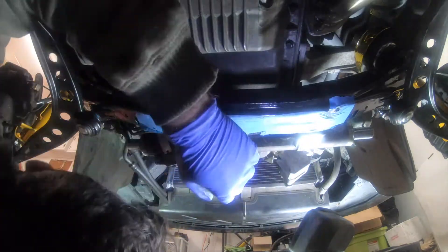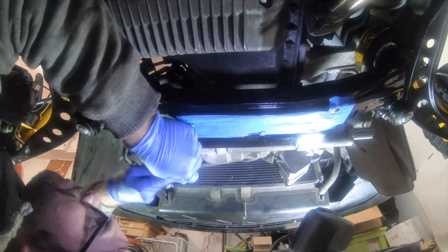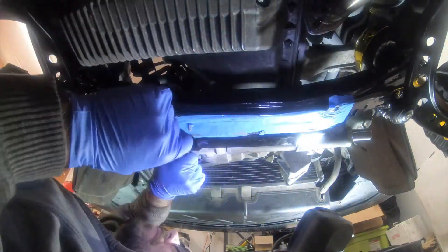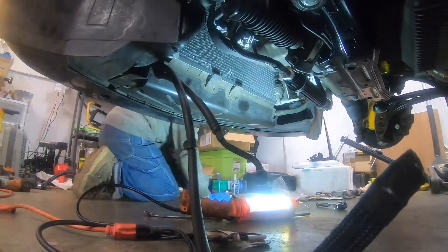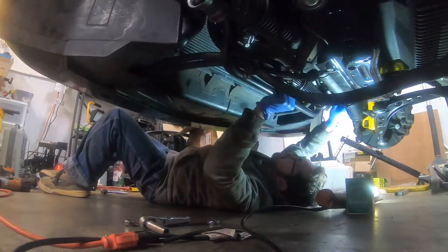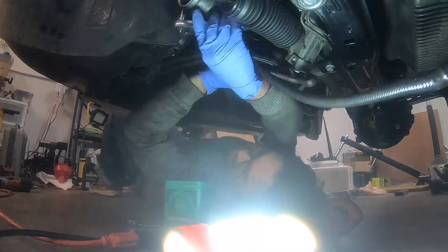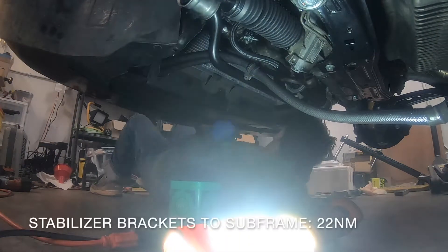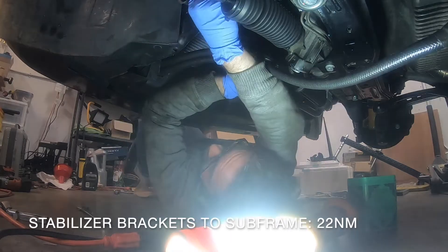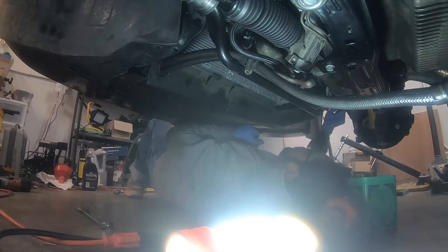After the rack was installed, I installed the new tie rods and bellows using the old tie rods as a template for how long to extend the outer end of the tie rod. You might notice the aftermarket power steering lines and power steering fluid cooler fastened to the rack, which is part of a Chase Bay system. Even if you're not replacing those power steering lines, you'll need to tighten them back up and go through the proper procedure to fill and bleed the power steering system. Here I'm also using fresh OEM rubber sway bar bushings, which is a good thing to do while you're in there.